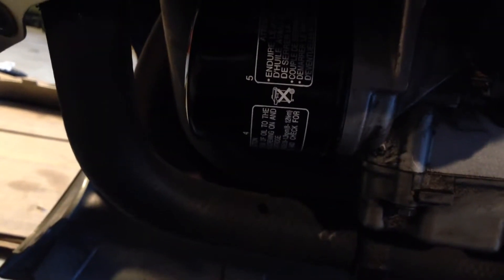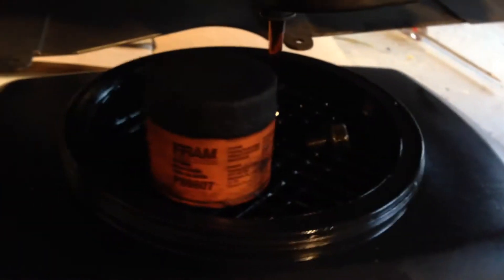You've got the new oil filter in. The old one is right there at the drain pan and you can see the old oil is draining out. It's still pretty good oil. I'm changing it out once a year and I'm not even putting anywhere near the full service life mileage on the oil. So it's still pretty clear, but I get the oil out anyhow because after a year it's pretty acidic just hanging around in the crankcase.